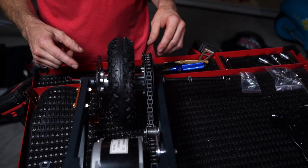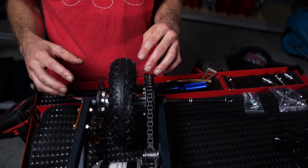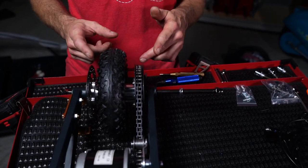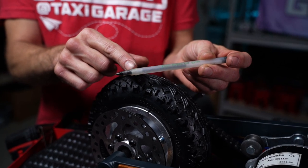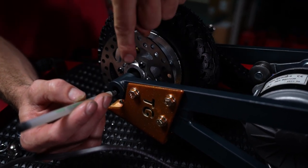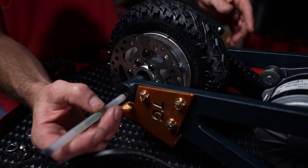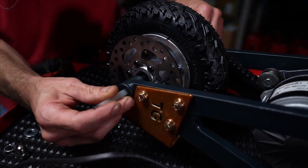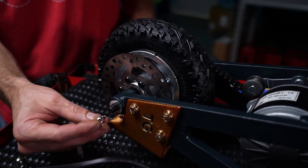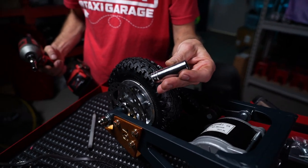Start on the gear side, fish in the spacer there, lift the XL fork, and slide the axle bolt through one spacer. The center spacer inside the wheel doesn't always sit centered, making it tricky to slide the bolt back through. Use a Bic pen or pick to address this — slide the tapered end of the pen in at the lowest point, feel for the center spacer, wiggle it up, and your axle bolt slides through nearly effortlessly. Put the flat washer, lock washer, and axle nut back on, then tighten with the 16mm socket.